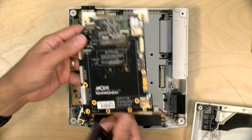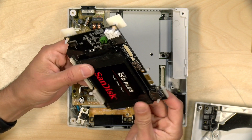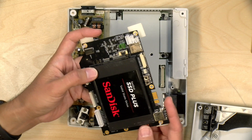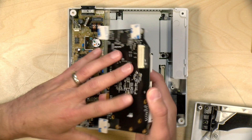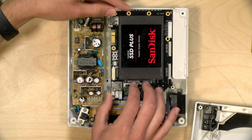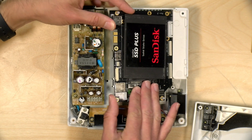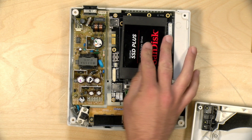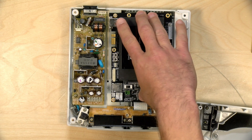Let's get the hard drive detached, put it inside the card, and then boot the Dreamcast up. We're going to pop the hard drive into the SATA connector. I'm going to go with the SATA drive because eventually I'll probably get a large one-terabyte SATA drive just to leave in the console — you could probably fit a good chunk of the library there. All we need to do is get this connector lined up with the connector on the board, and that is pretty much the entire installation — it's really that simple. Normally you'd want to screw everything down and get the sticky stuff going. I did find the standoffs a little difficult to work with as far as getting things to fit in the case, but once it's in it's in. Make sure your hard drive is in place and screw it down to keep it from moving around.